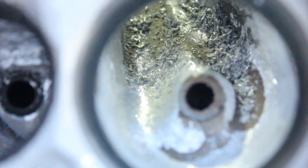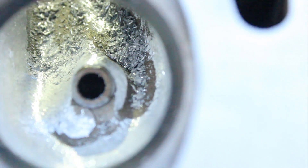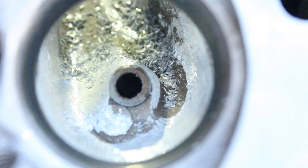After a couple passes with the grinding bit you can see what happened — we cut down the swirl ramp casting, made it more pronounced to match the other side, then went in and widened everything out and smoothed it. We'll go back through and blend it all with the sanding discs. Here's a stock one for comparison — you can see the big step-down it has, and on our ported side we ground that down so it's a smooth transition all the way through.